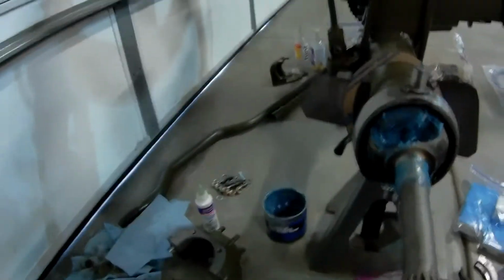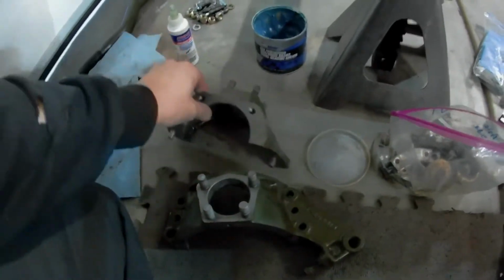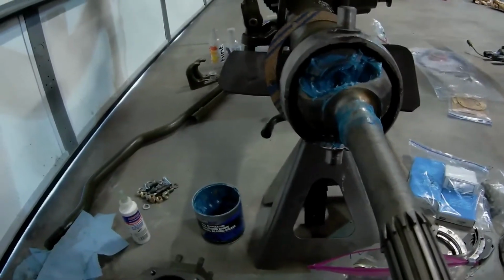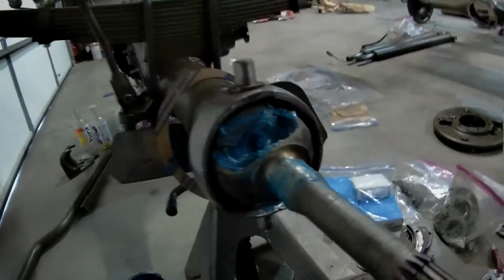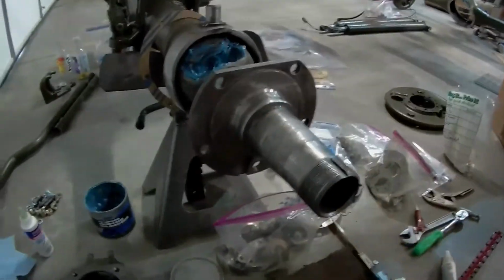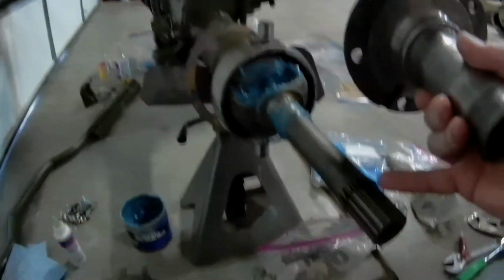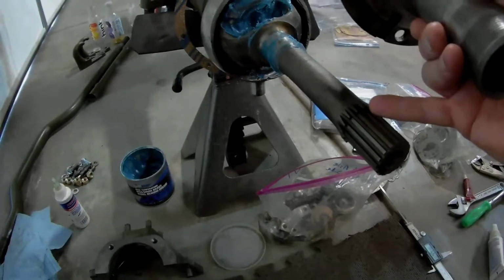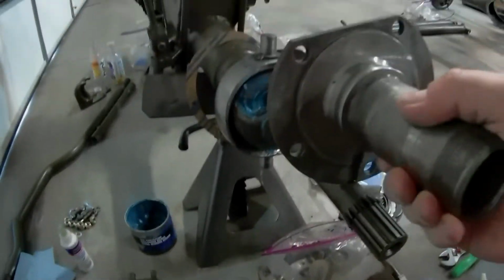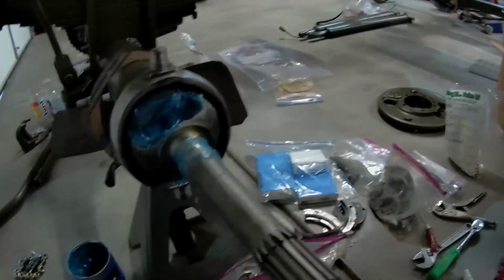4.382 inches. So once I get these knuckle pieces mounted on here, then I'll push this on, which kind of seats right up in there. And then I measure the distance from this ledge right here on the splines right to the curve in here. That's what that measurement is supposed to be. So I may bring the camera back and show that when I get to that point.